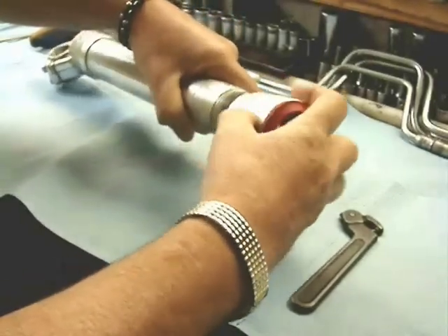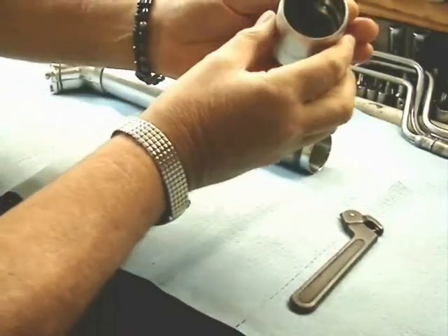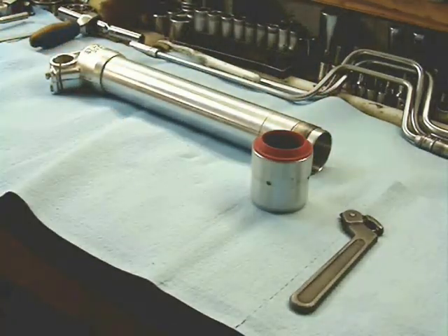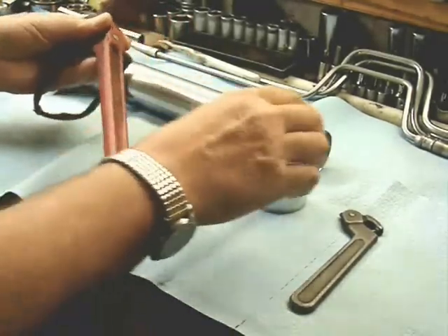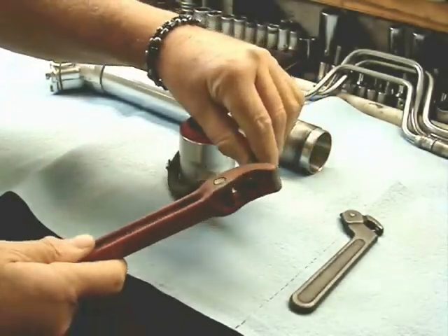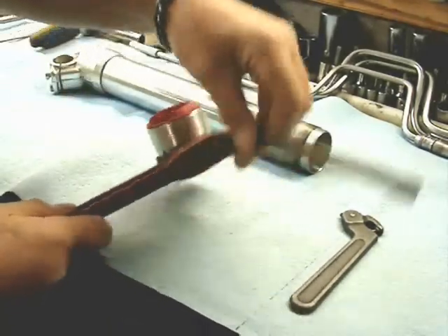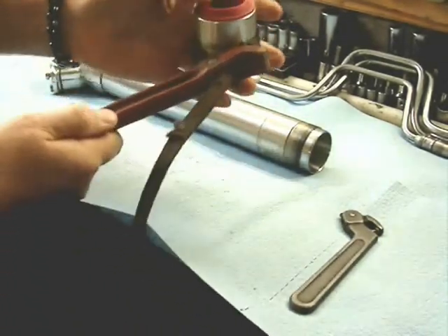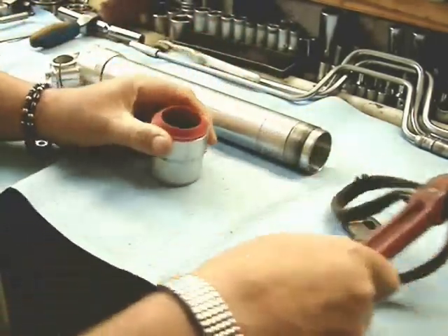Once you've removed this cap, there is an O-ring up in there that actually seals it to the fork leg. You can change the seal and work on it on the workbench. If you don't have a spanner wrench, there are different types of strap wrenches — I show here a cloth one that can be used. You wrap it around there to get it loose and to tighten it. Please don't use locking pliers or anything like that; you'll mar the finish and possibly crush and ruin it.